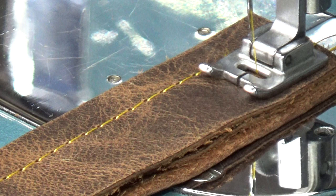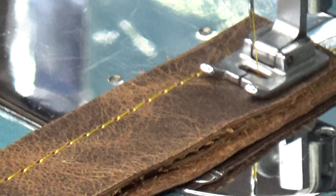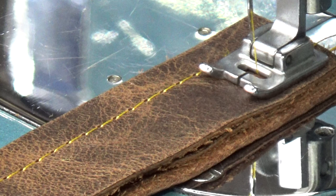We absolutely are. And did I also remind you that we're not sewing with a heavier weight type of thread? We're sewing with basically a 40 weight embroidery thread, folks, and a non-leather needle through three layers of saddle grade leather, about 12 to 14 ounces of leather. I'm getting so excited I'm bumping the camera. Look at that. It's an earthquake. Oh, that's actually my heartbeat right now. We're gonna give it a try, folks, because we don't know if we don't try, right?